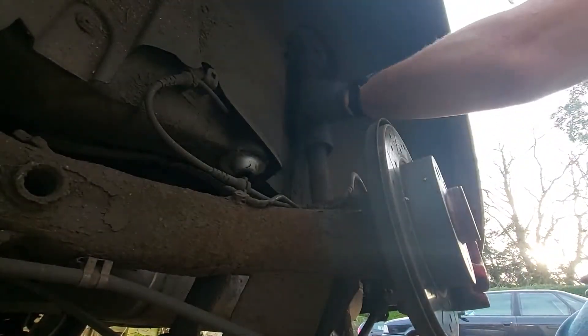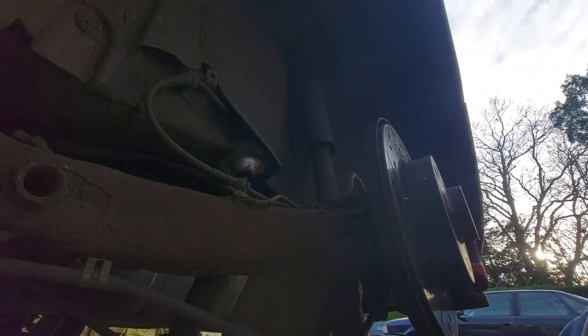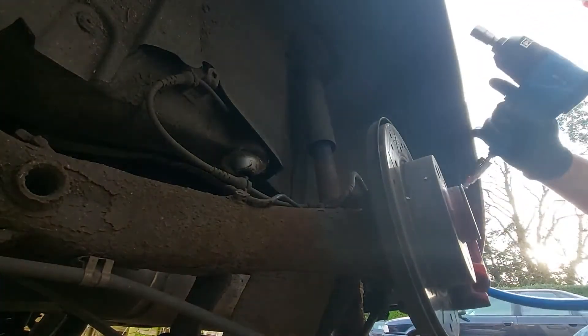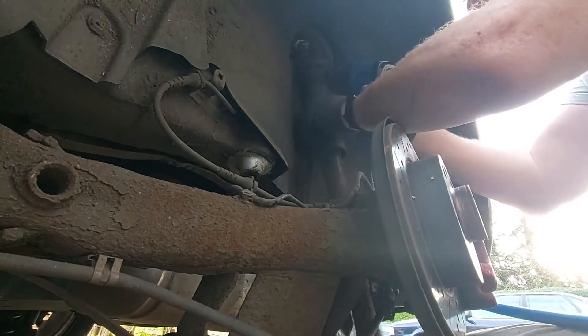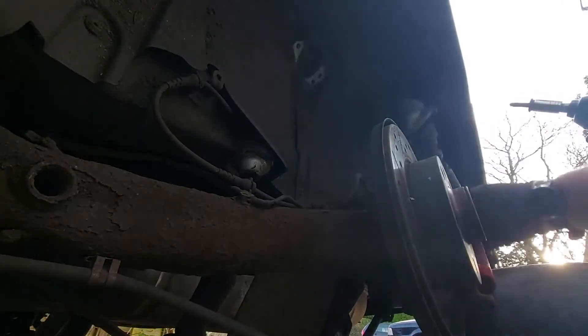Hopefully you'll be able to see this up here. I'll pull this down and you can see this rubber's in a pretty sorry state. There are two 16mm bolts up here that we just need to undo. And that is the shock absorber out. It's ever so nice for this car not to be fighting this for once.